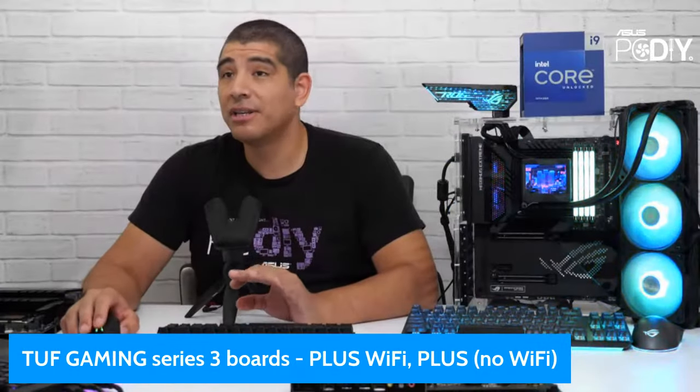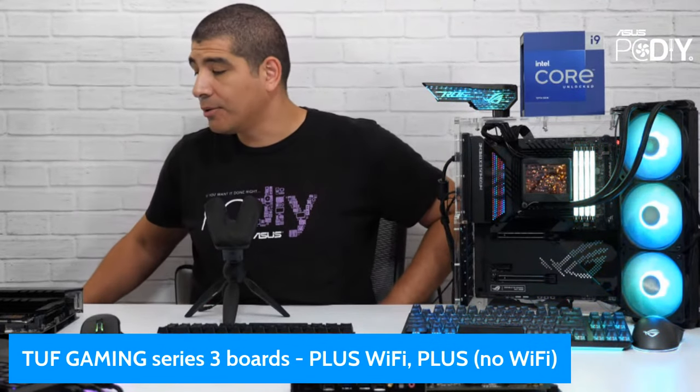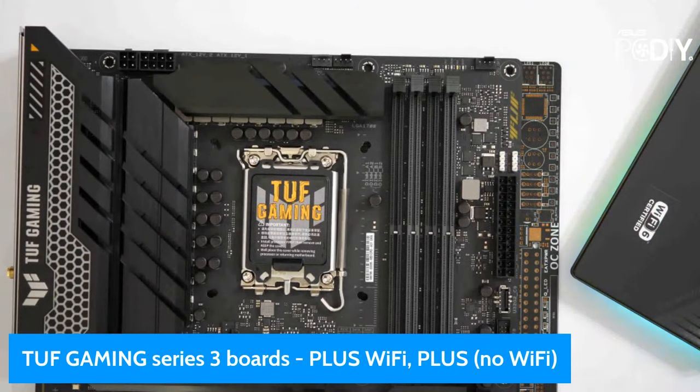These boards also do not feature the ASUS AIOC technology. That does not mean that you cannot overclock them. It just means that you are going to manually overclock them, either using XTU or doing it in the UEFI BIOS. You just don't have the one-touch options to be able to easily and effectively overclock the CPU based on your CPU and then your CPU's cooler, right?